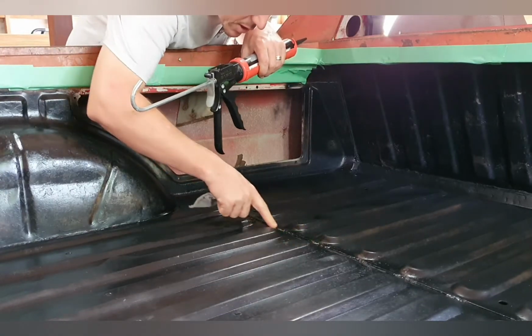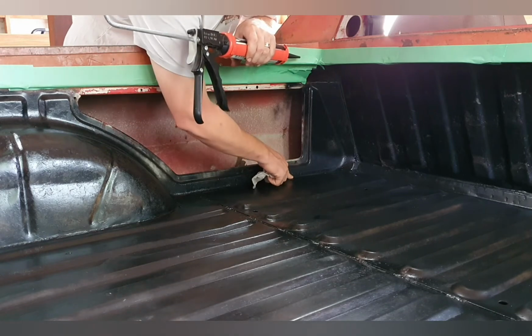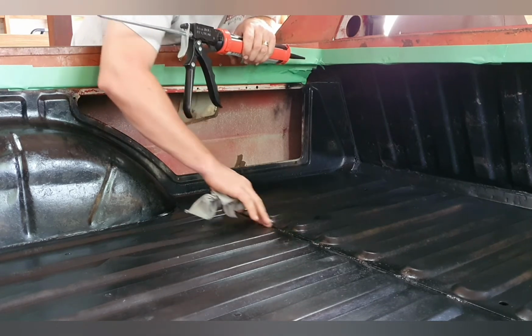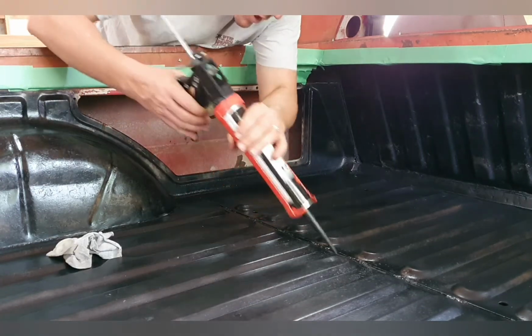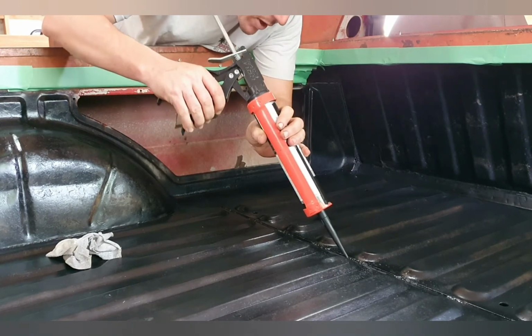Who would have thought? So, I'll show you through the product and what we're going to do, and we'll go for a journey together. So, these joints here in the tray, and around here, it's all fairly exposed. I've got a fair bit of surface rust there. It was pretty pitted. And last night, I came down here and just laid in a really heavy coat of zinc paint in there as well, just to sort of get in under that extra paneling there and seal it all back together. Just so that we don't get any water ingress or anything in the future.